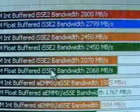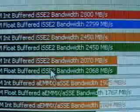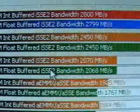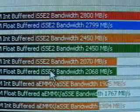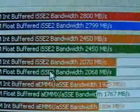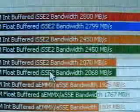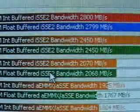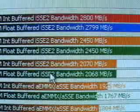The result I got here is 2800 megabytes per second. The reference result below mine is 2450, which is RDRAM memory not overclocked. This gives an indication that DDR memory is exceeding RDRAM in the current state because the OCZ AD DDR memory is so very overclockable. Again, at a 190 MHz frontside bus, this is the OCZ AD 3000 memory — 190 MHz means 380 MHz DDR.